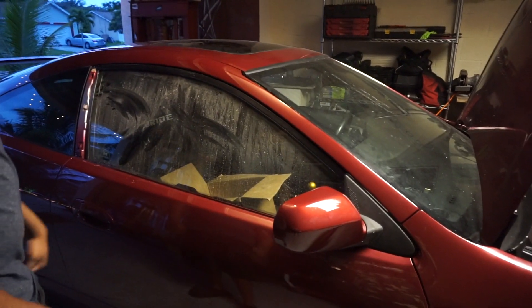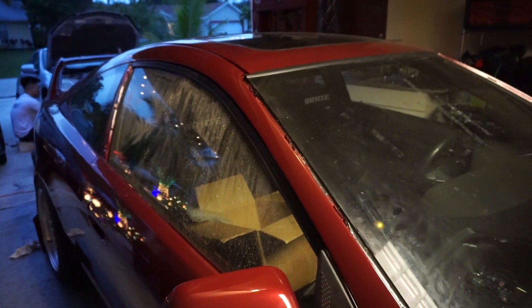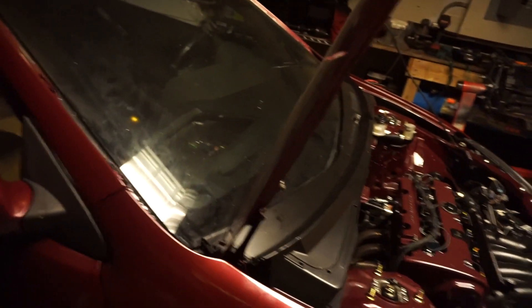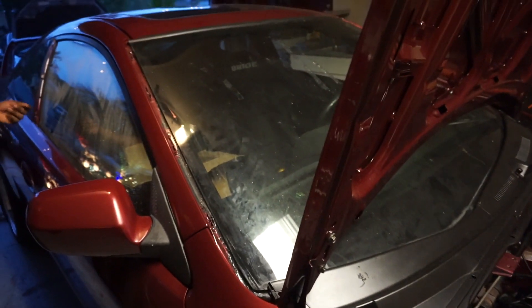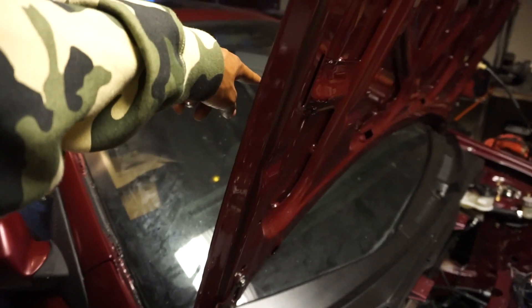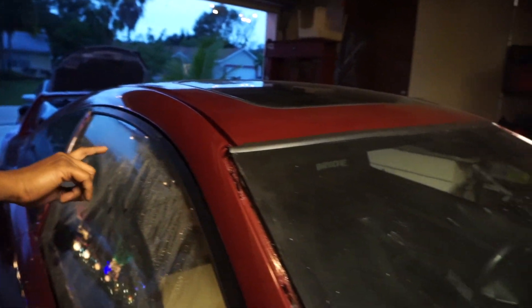So what did you do? You put power to that fuse - remember that 120 amp fuse we tried to power? We didn't get any voltage out of it, it was dead. So I put power to it and it lit up, so I know it's not nothing stupid. Maybe it's not the harness - that harness goes to the fuse box over there. That fuse box isn't getting power; one fuse for this side is not getting hot.